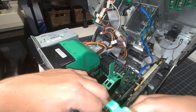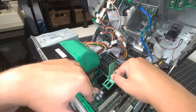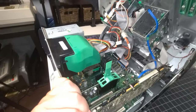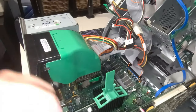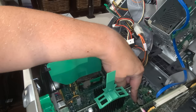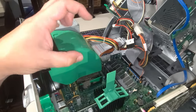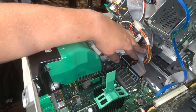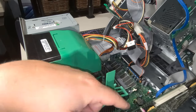So we have those cards reseated and the bracket back down holding everything in place — that's our clamshell design with the video card and RAM reseated. I'm looking at the capacitors because I've been running into some cap problems lately. When I say caps, I mean capacitors, which are known to go bad and leak on the board causing damage. But I don't see anything on this motherboard implying bad capacitors, which is really good news.